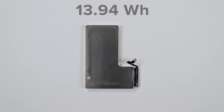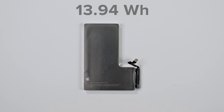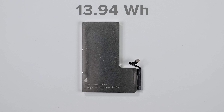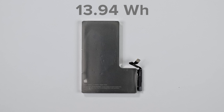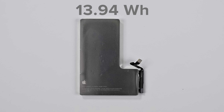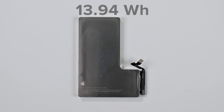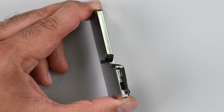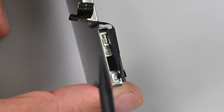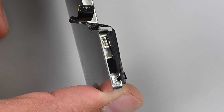Coming in at 13.94 watt-hours, the iPhone 16 Pro battery is actually bigger than the 12.7 watt-hour battery in the iPhone 15 Pro — surprising given the additional material surrounding it. Phones incorporate a certain amount of breakout space around the battery to accommodate potential swelling; a metal-encased battery may need less breakout space, leaving more room for battery chemistry. Another safety mechanism appears to be built into the side under the battery management system: a button-like protrusion that is probably a blowout valve acting as a pressure-release mechanism in the event a bad battery swells and creates excess pressure inside the shell.